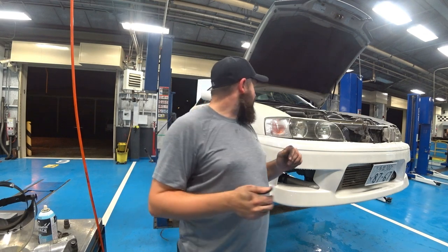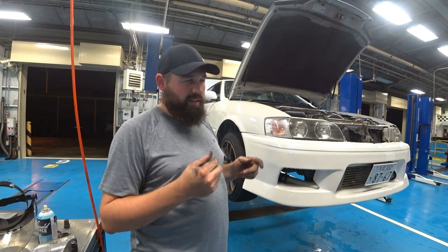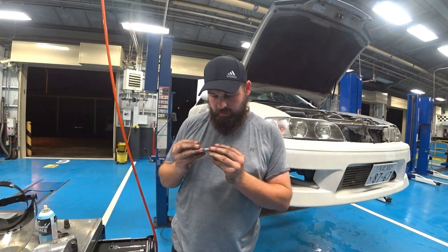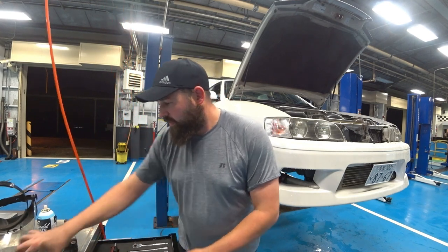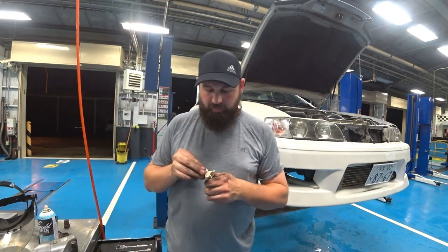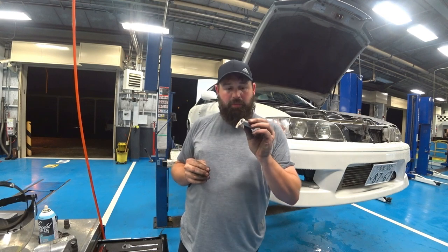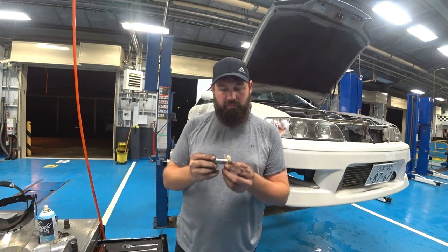The other two are on the clutch master cylinder. Just take those two nuts off. The top one, super easy, again, 12 mil. The bottom one, not hard. And the best trick I can tell you is to take your 12 mil socket right here and stick a piece of paper in it. You realize you actually grabbed the wrong socket for this nut to demonstrate, because that's awesome. So you take a piece of paper and stick it in your socket, and now you can feed the bolt in without having to worry about the socket coming out. A little handy trick.